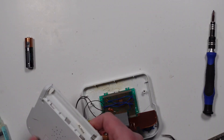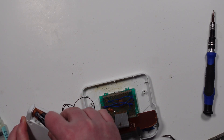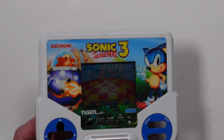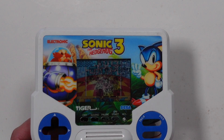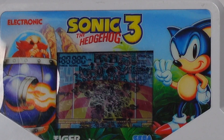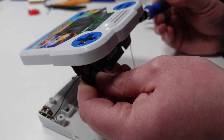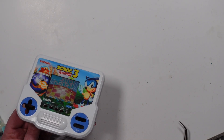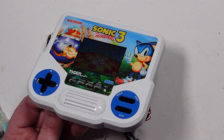That's done, and now it's all clean inside as well. Let's just see if it's going to make any difference — I don't think it will. It's still doing the same thing. So what could that be? It's not allowing the game to start. There's nothing wrong with the screen because when you reset it, all the characters display on the screen. None of the inputs do anything — none of the buttons do anything other than reset.